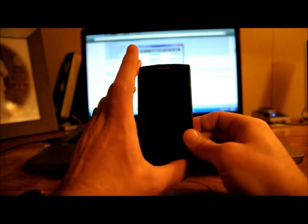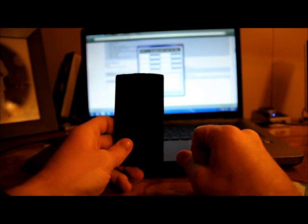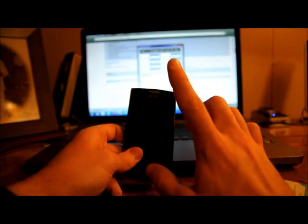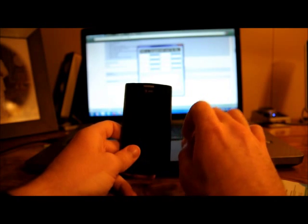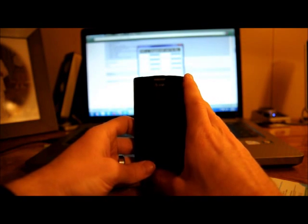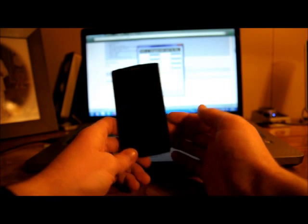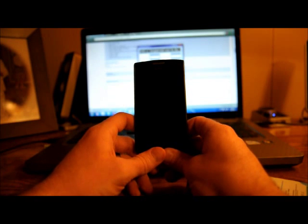I've already got AT&T Gingerbread boot loaders on here, so I'm going to flash back to this Gingerbread version, which is the KH3 version. I'll have a link in the description to this ROM. The good thing about this ROM is that it has a kernel packaged with it, and in that kernel it has ClockworkMod built into it. To flash Ice Cream Sandwich, you have to have ClockworkMod on your phone, and the only way to get it is by flashing a kernel that includes it. This ROM has all of that already packaged together.